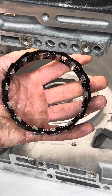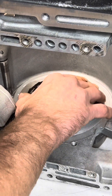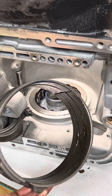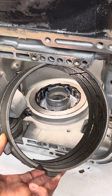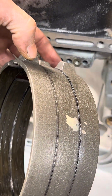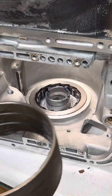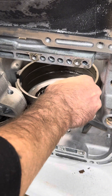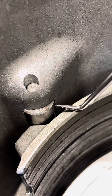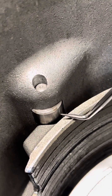Now we can install our rear sprag. Lube the rear sprag before we install the low reverse drum. The rear band does need to be in place — these two tabs are going to face the side of the case, and the solo one will face the servo. If this guide pin has been removed, make sure that it is reinstalled at this point.